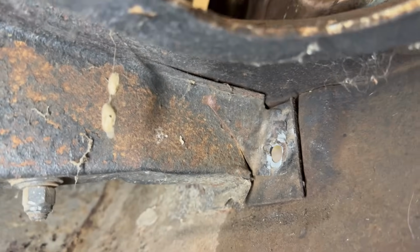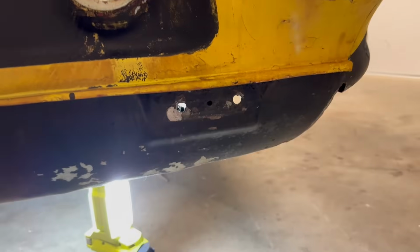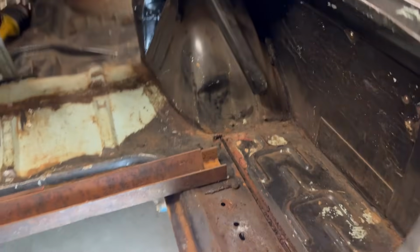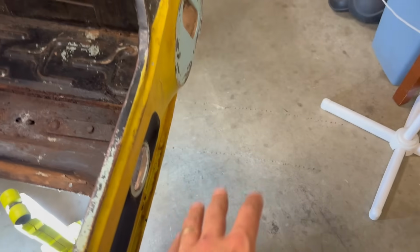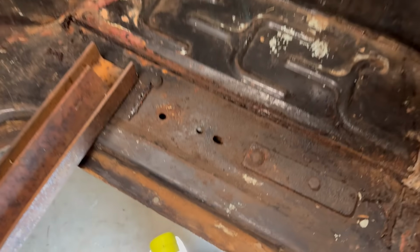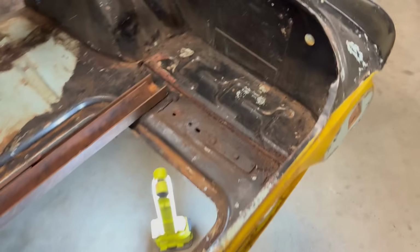So I was originally going to attach these rear mounts to these bumper mount spots, and these match up to the holes that you can see on the outside here, but I think that's just going to be a little bit too risky. So what we're going to do instead is have some long arms that come out underneath the car and then attach to the rotisserie point just here, and we're going to be able to attach those using these existing holes in the chassis rail from where a tow bar used to be fitted.